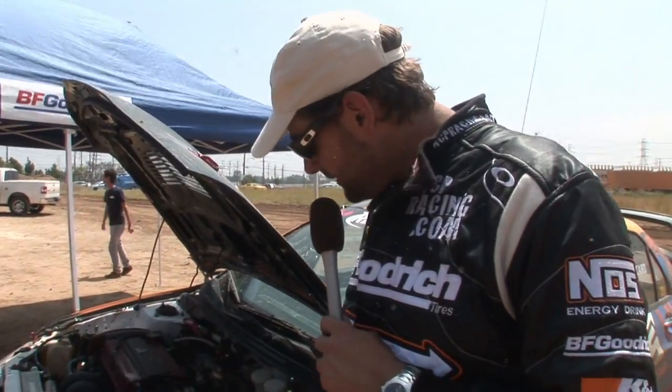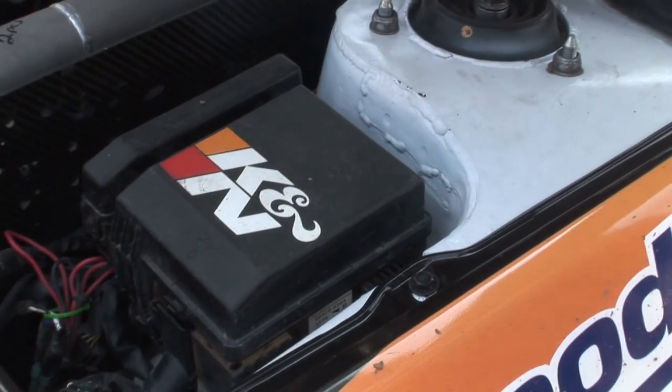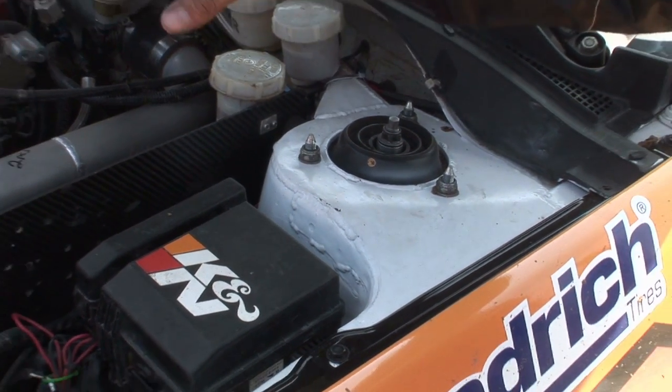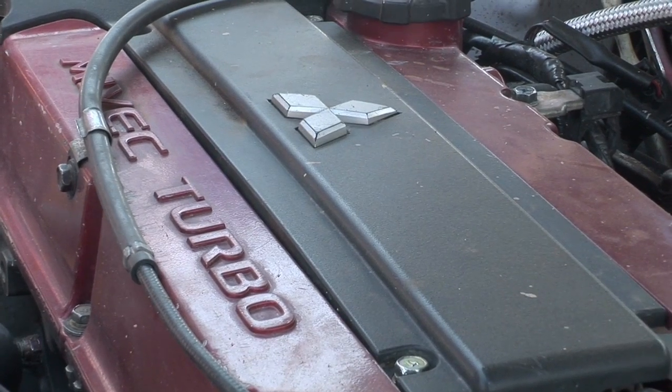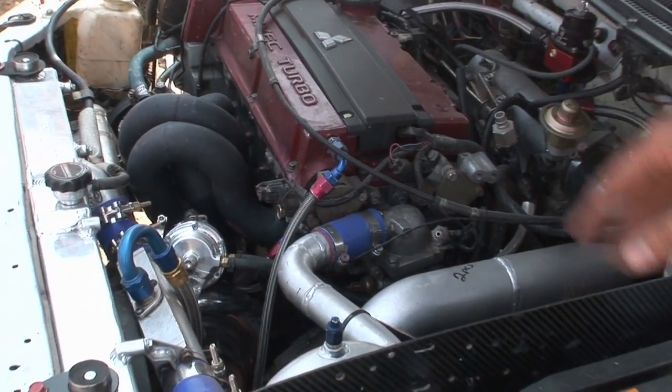First thing to do with a rally car, we double plate everything. So the shock mount here, you can see, has got a twin plate on the top, a bunch of strut bars that go back and tie into the roll cage. We build a more powerful motor, in this case a stroker motor, 2.3 liters up from the standard 2 liters. This one has a huge turbo on it and a manifold which is specifically for X Games, and make a bunch of custom piping and things.